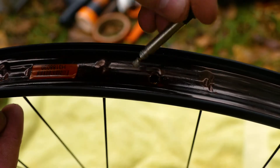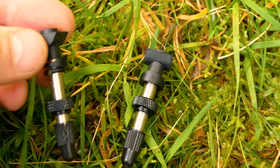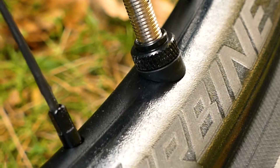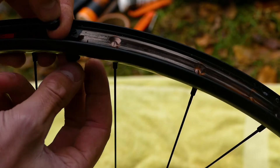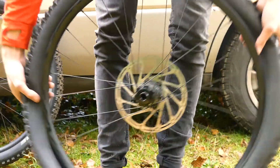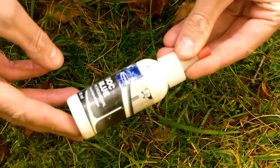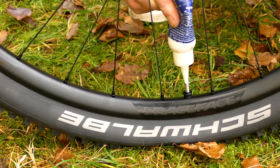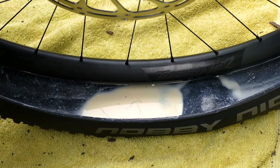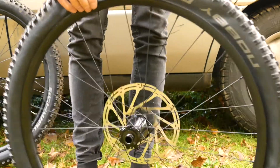After that, cut a little hole and jam your tubeless valve through the tubeless tape. Install your tubeless valve — you can see I have this little plastic spacer here because I have asymmetrical rims, so this makes it seal a bit better. After that, install your tire by popping it on both sides. If you don't have the little squeeze bottle to inject sealant through the valve, just keep a bit of the tire open, pour the tubeless sealant in, and then pop the tire all the way on.